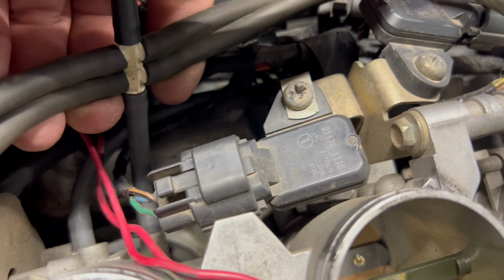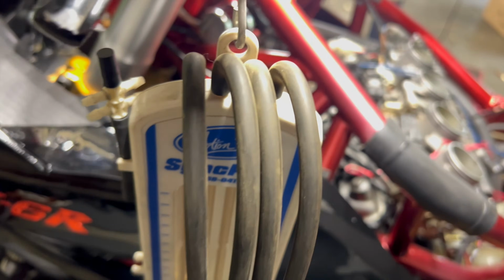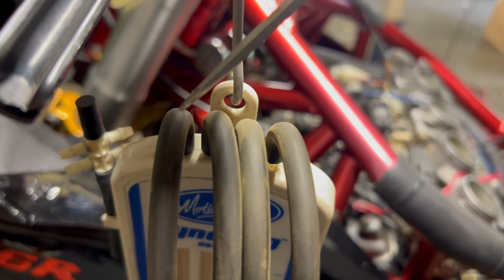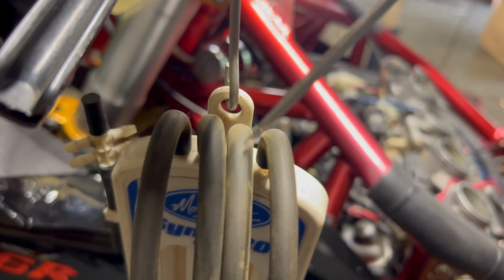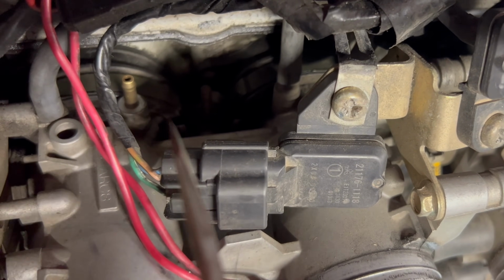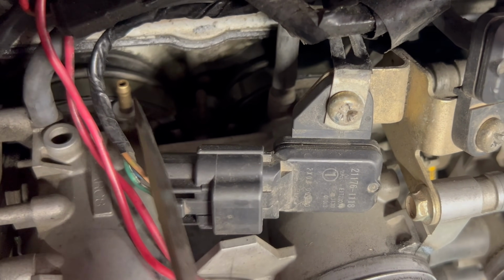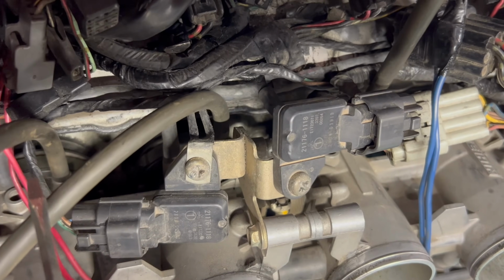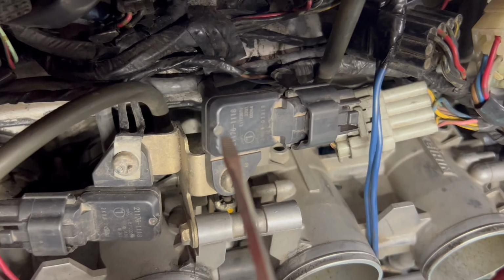Take off this air box. All right, next thing you need to do is take off this T. Alright, now we're going to go ahead and hook up these hoses to each and every one of these cylinders. This is 1 cylinder, 2 cylinder, 3 cylinder, 4 cylinder. On this throttle body, there's 2 vacuum lines, so what you got to do is hook each and every one of those hoses to the right cylinder on the right side vacuum line. Just like that, each and every one of them hoses on the right side vacuum line on each cylinder.